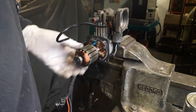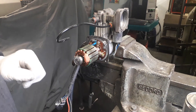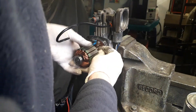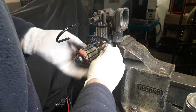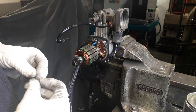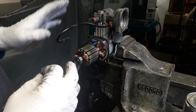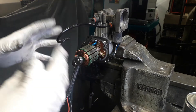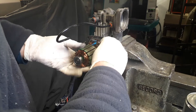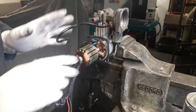I do recommend this specifically on Range Rover L322 — it's a good process to do. This motor needs to spin over really healthily. You always need a good fully charged battery on the vehicle, because the difference between a depleted battery firing the compressor up and a fully charged one — you can actually hear the difference — so it does make a difference on the pumping output as well, but generally they run fine.